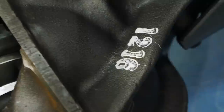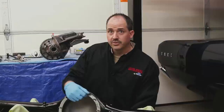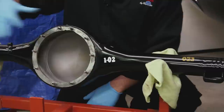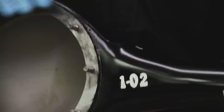Another paint marking you'll find on a center section are numbers that are the date code for when the actual center section was assembled. Our vehicle was built January 5th of 1966, so we dated this center section as if it was built December 16th, 1965. Another number you'll find on your rear end is the date code for the whole rear end assembly. The center section was dated December 16th when it was built, and this number — January 2nd, 1966 — is when the center section was married to the housing and the axles were installed.